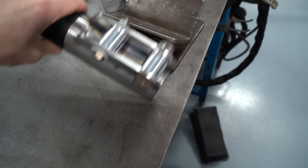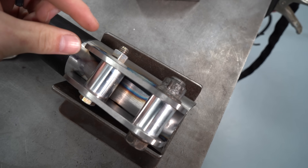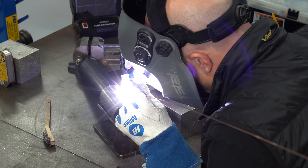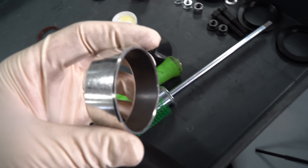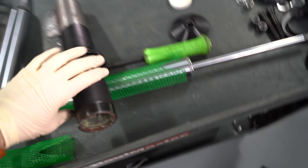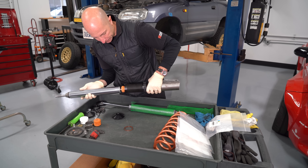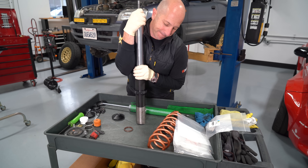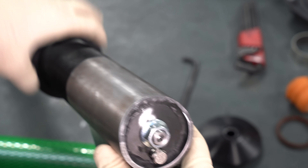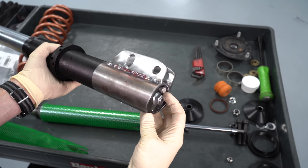After some measuring, I cut out and welded the tabs to fit the RAV4 front uprights. We made little aluminum spacers representing the thickness of the factory upright so that when you weld the tabs on, they have the right width and bolt properly onto the factory RAV4 upright. Inside the strut there are two bushings and a seal on either end to keep the grease in between. The shock shaft screws into the base of the housing with a secure nut on the bottom, holding the shaft in place while the strut body plunges up and down inside the housing. A small filter vent allows air to escape from the bottom part of the housing.